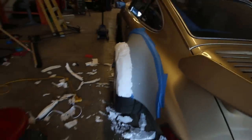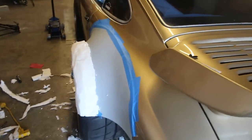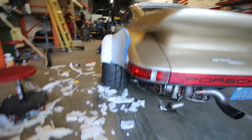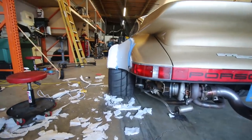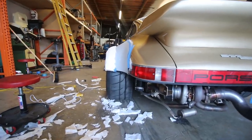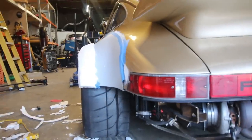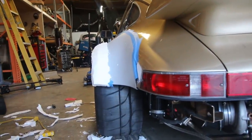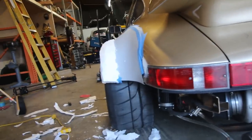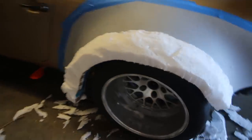What I'm basically trying to do is just get the shape right, taking a little bit off at a time. This stuff is a lot like styrofoam. It doesn't need to be quite perfect because it's gonna be a little bit smaller than the final form — we still have to lay in body filler and sand it all even. So just taking a little bit off at a time so we don't have to buy more cans and wait another 24 hours.